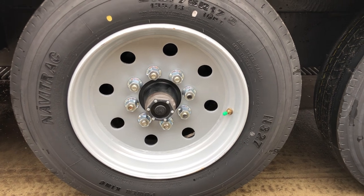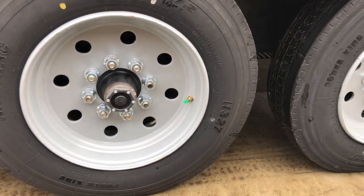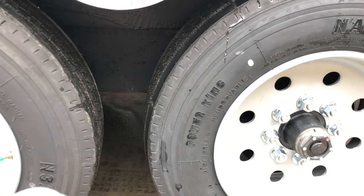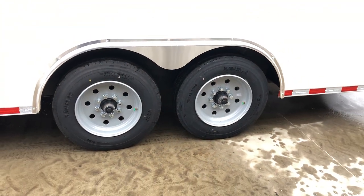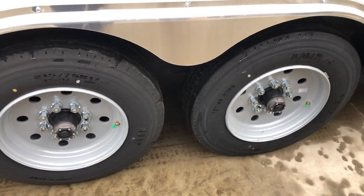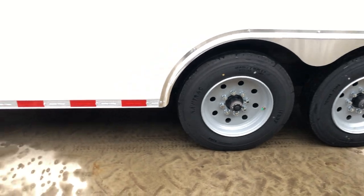It goes to heavy studs. Also on these, you've got the new Valkyrie aluminum caps as opposed to the plastic-style caps — certainly much more durable, last forever, no UV issues. You'll also notice there's no equalizer, because this is a torsion axle trailer. It's got 8K torsion axles with the newer-style brakes. Also, notice the green cap — this is a nitrogen-filled tire. Nitrogen doesn't have the moisture that traditional air would, so it helps keep the tire from dry-rotting from the inside out.